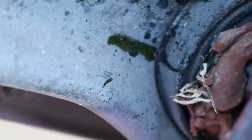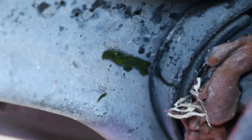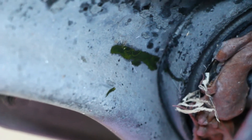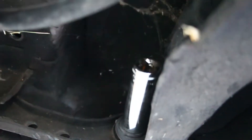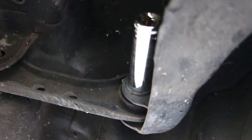Typically looks good. Generally this is how you want to do it - I'd probably prefer white-out or something. Now that we have the position marked, it's time to actually take the trailing arm off. It's gonna be right there where that socket is - that's the first bolt you want to take. I believe you can access it from the back; if not, you have to go to the front. Unfortunately I don't have any space, so you might need an actual wrench to take it out.